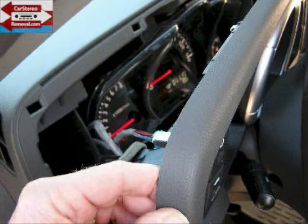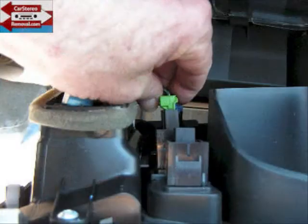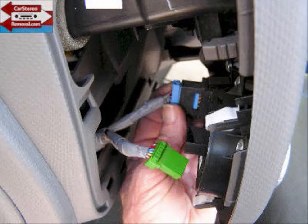We're going to move over to the left side of the steering column to the top of the panel and find the dash light rheostat switch. This connector also has a trigger on the side — squeeze into the connector and remove. In this particular model, below the dash light rheostat, we have the roof switch — squeeze the trigger and remove that connector. Then move down to the far bottom left corner and release the connector from the headlight switch and the cargo light switch.